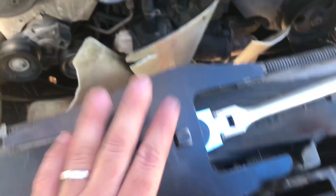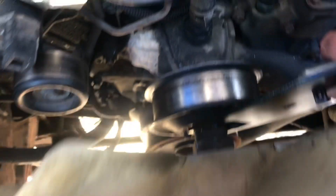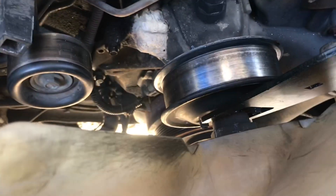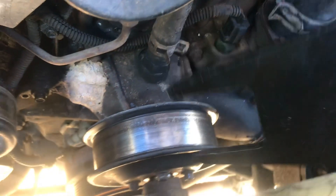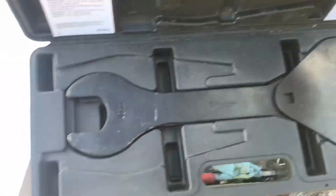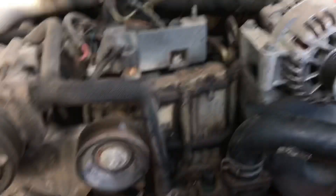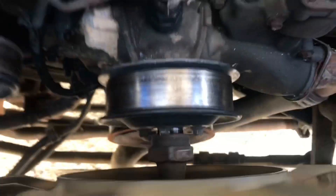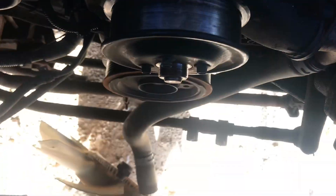As for the removal tool, I went ahead and went to town and got the rental tool. Totally worth it. This just clips onto a half-inch drive breaker bar or ratchet and sets right on your pulley. There are four bolts there on your pulley that make a square pattern — that square head fits over those four bolts. It comes with wrenches too to get on that big nut on the fan clutch, but I just used a big crescent and it broke loose real easy. Now I've got it broke loose and we're just spinning it off. Whoopsie! Oh well, fan's broke anyway.